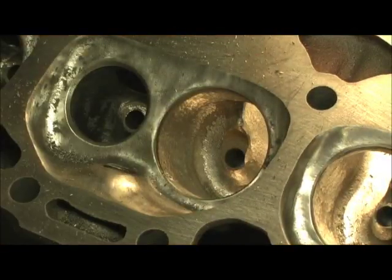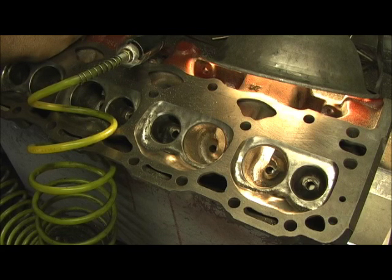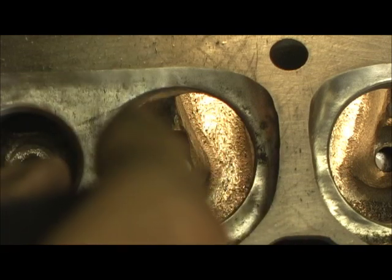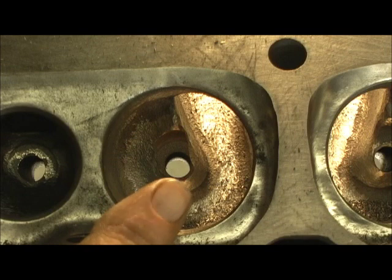I'll do that when the head's turned in the reverse situation. It's the hardest bowl job to do that I've ever done because there's so many little things in here that have to be just right in order to make this come out. I have increased this area here to here almost 25% over what it was stock. There was just nothing coming through — they were just squeezing this too hard. It's still going to swirl, but the swirl is going to be more noticeable in mid RPM.